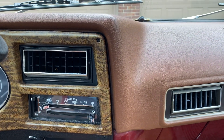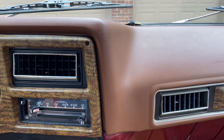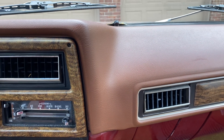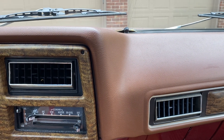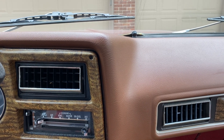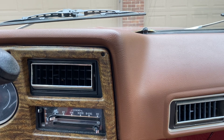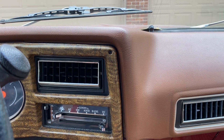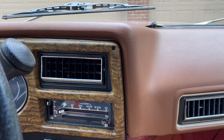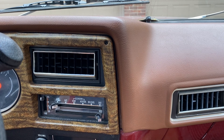The Bring a Trailer family had a couple questions on the 1975 C20 Chevrolet Scottsdale and the AC and heating unit, so I'll just do a quick demonstration of how everything's working. As you can read in the description, we completely overhauled the AC system. I know there are a lot of fans who want to cruise with their family in these trucks, so it's critical the AC system works. We changed the accumulator, changed the AC compressor, and did a full switch removing the R12.